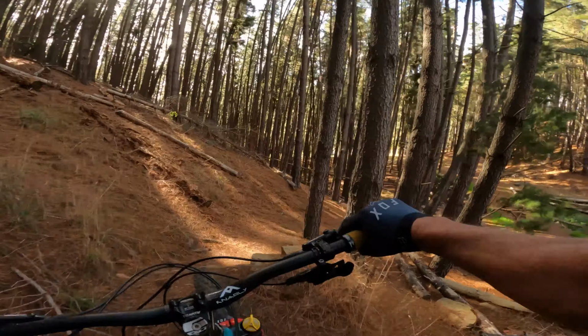Like before, my feet used to bounce around on the pedals a lot through all the hard chop stuff, whereas now, yeah, it's nice and smooth. So that is good. I reckon I could go a slightly lighter spring to sit the bike into the travel a little bit more on the trail on that light compression stuff, but still I've got a lot more confidence to hit drop-offs and square edge hits now, because the bike absolutely just soaks it up now, whereas before I pretty much found the limit of the suspension straight away, and it was usually a harsh bottom out.